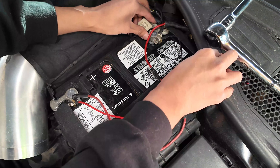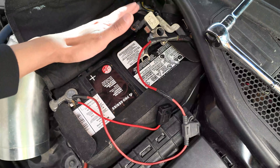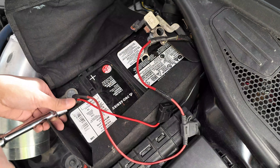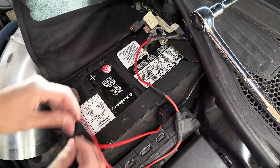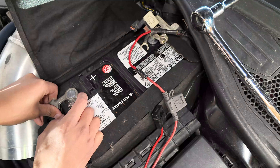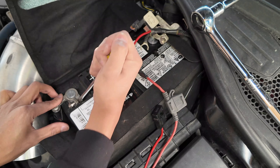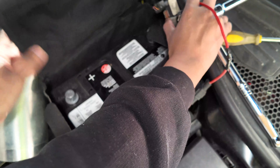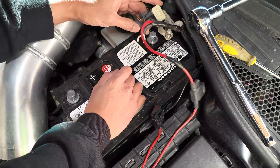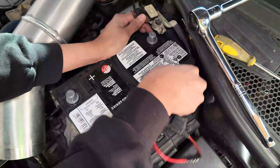I have extra electronics hooked up, so I'm just going to remove all these carefully and put them off to the side. Now, once we have the negative terminal disconnected, we can go ahead and remove the positive side. The terminal, once you've loosened it up, should lift right out. If it's very tight between the terminal, I'd recommend using a flathead screwdriver just to pry it a little bit. Usually the cover is loose and you can pull it right off. When removing the battery, make sure the terminals do not accidentally touch the battery — nicely tuck them away and zip tie anything you need.